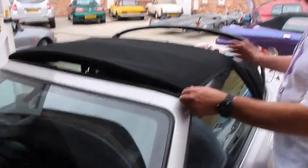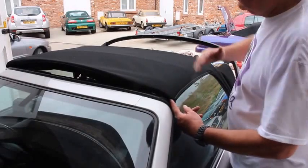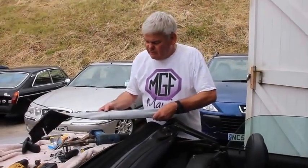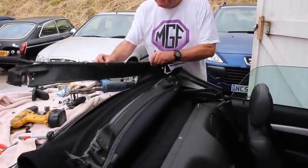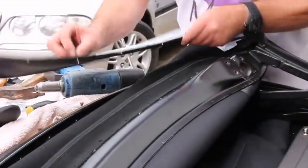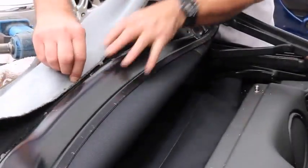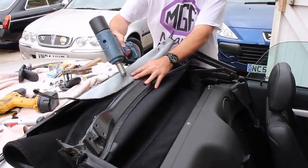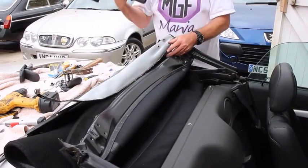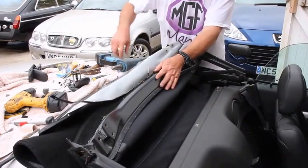Okay. So now we stretch this out, we can see the corner is fitted correctly, so we now need to just re-glue the front section. So now we re-affix the header rail cover. We put the rivet through the centre hole, which is circular, all the rest are elongated, and in the centre hole in the frame, once it's in place, we rivet it. Then we just continue along, firstly one side, then the other.